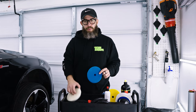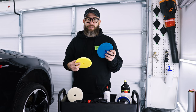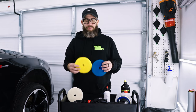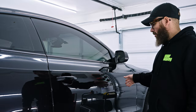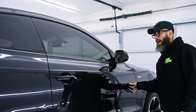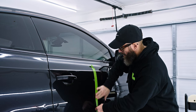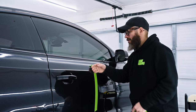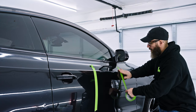Medium aggressive polish with an aggressive pad removes paint much quicker but also creates heat — you have to be very careful with these combinations; there are rules and a process to use them effectively. What I'm going to do now is divide the door panel into two sections, try a light combination on one side and a medium pad on the other, and see what results we get. This is in order to test the pads and find what combination works best.